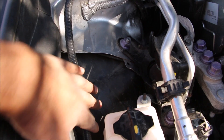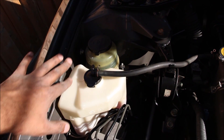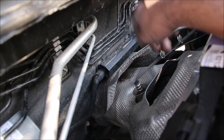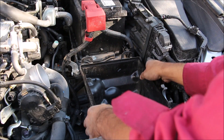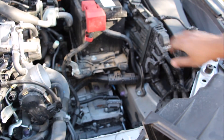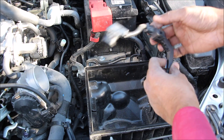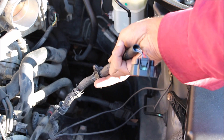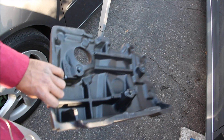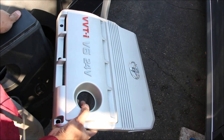The exhaust shield on the new one is pretty thin, and a little bit thicker material on the old one. There are also savings in fasteners — things just snap right in — and a shorter wiring harness for the ECU by placing it outside. Newer cars use plastic pieces to guide and clip wires in, but once they break they're kind of proprietary to replace, whereas older vehicles tend to use generic plastic clips on the harnesses. The foam engine cover on the new car doesn't look great but is probably good at sound deadening, whereas the old one has a nice fancy looking cover.